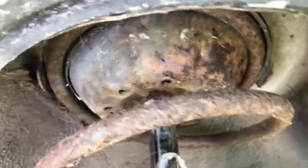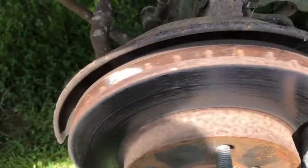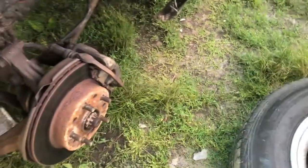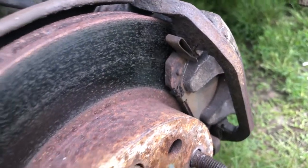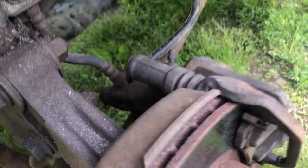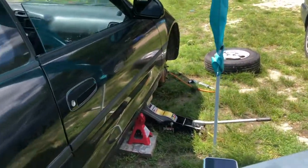We're going to scrub it down and lubricate all these little parts. Obviously you don't want to lubricate the new pads and rotors. What I'm noticing is the pads in the front are actually really solid still — they have a lot of pad left compared to the rear. The rears are just gone, really. One side has a little bit left, but the other side is probably the worst — it has like nothing. I think those pins need to be lubricated, but yeah, we're going to lubricate all of them.